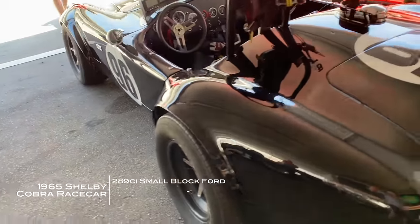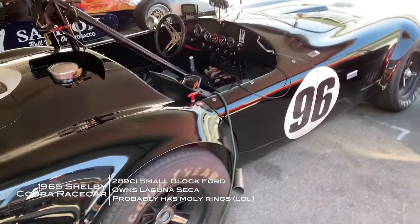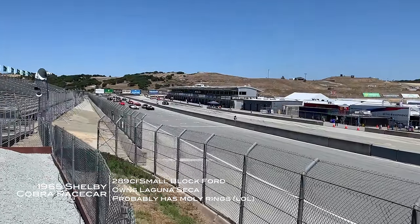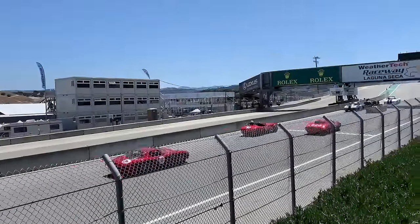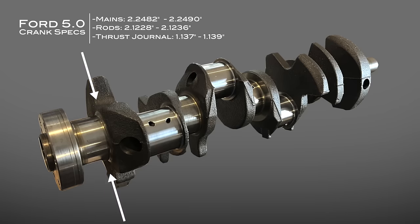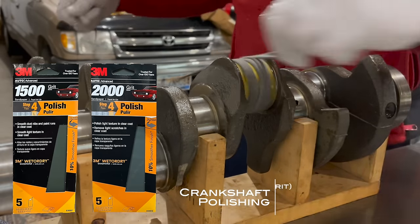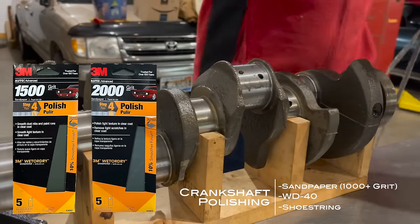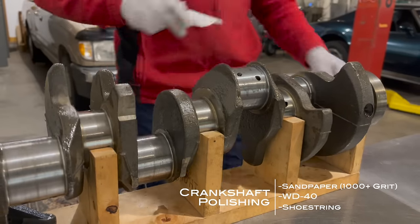I was not building a high performance motor, so if you're building high horsepower, you definitely want a superior piston ring. My crankshaft was in spec so I just replaced the bearings. But if a crankshaft journal is undersized or worn too much, you can actually buy oversized bearings that have an extra thou or two of material on them to bring it back into spec. You wouldn't do this on a race engine — you'd regrind the crankshaft — but for a budget build it's something to consider.